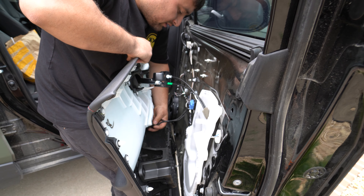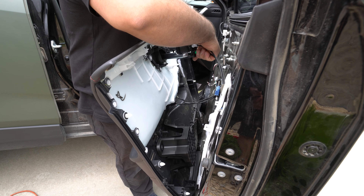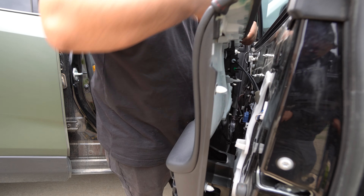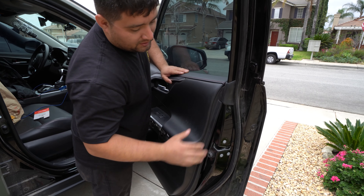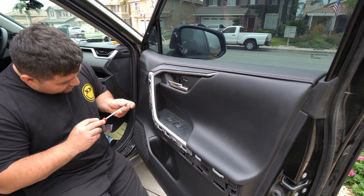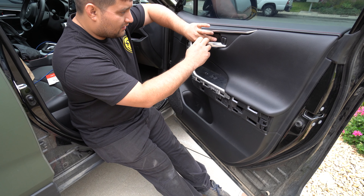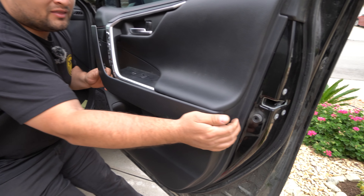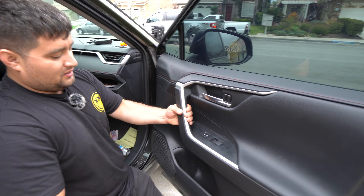At this point, you're going to put everything back together. Connect these connectors here at the bottom again until they click, give them a little pull to make sure they're in there. This handle kind of angles in, hooks in the front, and just pops on just like that. Now you're going to bring it up and over the gasket here, kind of set it in. Then once that's in, you can clip it in. On this one, there are three hooks — you're going to start in that section, hook it first, and then you can smack this on just like that. And boom, you have your door panel on.